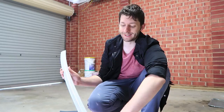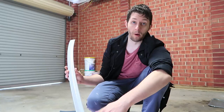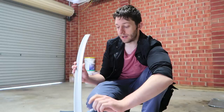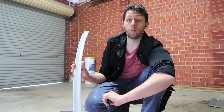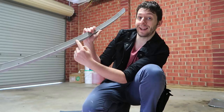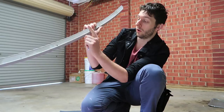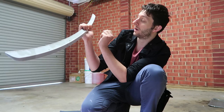Because this was pre-primed I'll still be priming it again just to show you how it's done and for peace of mind — I don't know what primer they've used so I just want to rub back some of their primer and put my own on. What you want to do when you're sanding is keep going until the finish is matte — when you look at it in the light there shouldn't be much shine, it should be really dull, and that means your next layer of paint or primer will stick well. Make sure you sand all areas, even underneath, because paint will end up there and if it doesn't bond properly it will start to peel, and that will take the visible paint with it. So prep the whole part nicely.